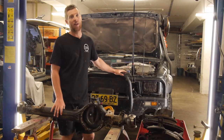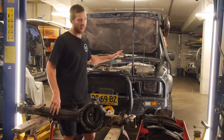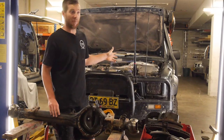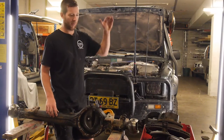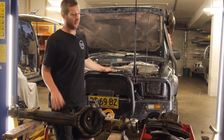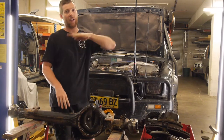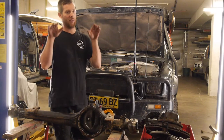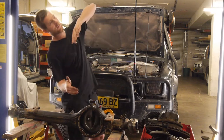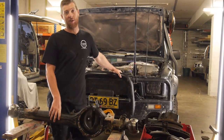I've done everything I can to get the geometry set up as best as I possibly could and it's still not that good. The rear end works amazingly — it's a coil rear, flexes like an absolute demon — but the front literally would have probably a hundred mil from fully compressed to fully drooped. So you'd be going through wombat holes and washouts and the front end basically stands solid like it's fixed, while the rear articulates through. In big ruts the front just stays solid and tips the car up on its side, which happens a lot.